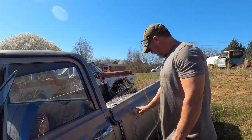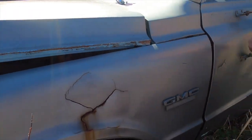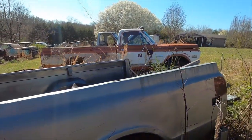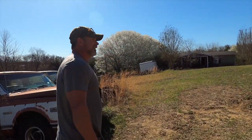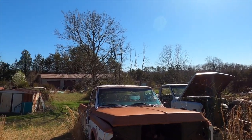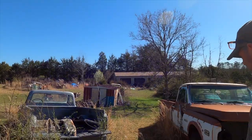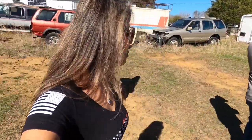This one's been worked — don't look bad, but you can see it's been touched. People have their hands all over it, you don't know what kind of damage it is — it's full of bondo. So you'd be starting with something that's rough in the first place, or covered up and you don't really know. Once we strip back the paint we'll see what we've really got. I find it's good to find one that an old farmer has had and put up in his barn — been there for 20 years. It looks like we're going over there to visit the farmer next. It would probably be more money, but it'll save us time and cost in the long run if it's complete and you know what you've got to start with. That's the thing — to save shortcuts now, you're just looking at a bigger headache later on.